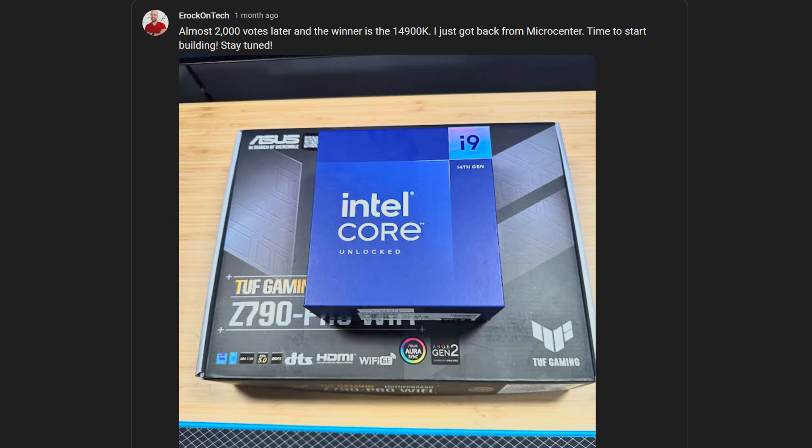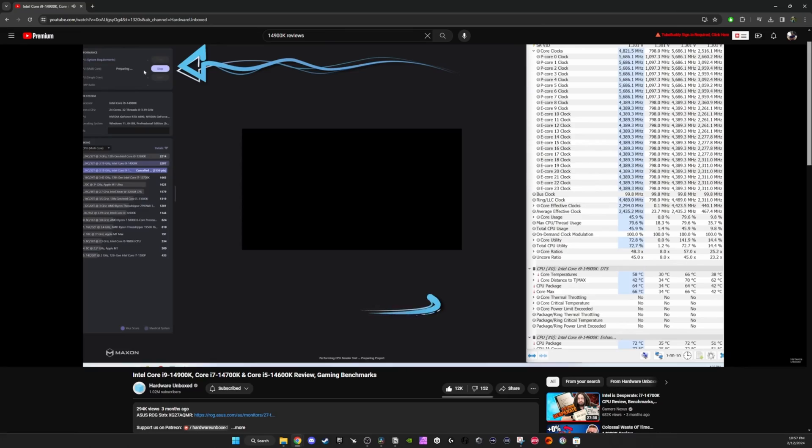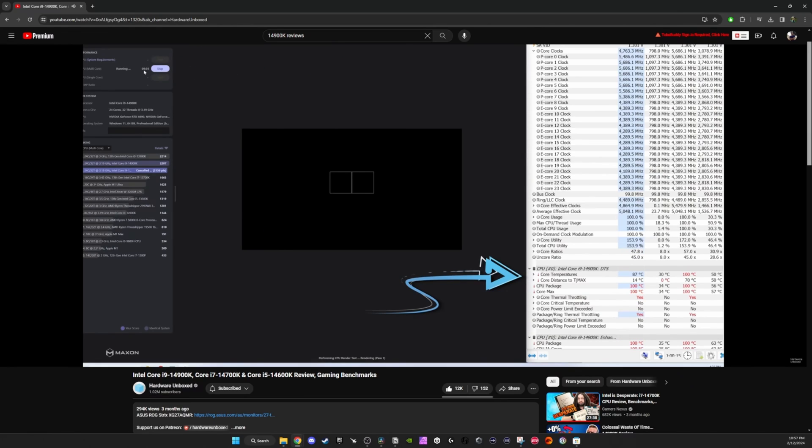I'm sorry I didn't clarify that — now I am clarifying it. Now I can tell family and friends: whenever you buy an ASUS motherboard and an Intel CPU, if your temperatures feel a little too high, go into your BIOS, check the setting for 'Disable Enforce All Limits,' and your maximum wattage will be capped, bringing overall temperatures down. To re-clarify: in my previous video I did not clarify these settings — that was my mistake. I also ended up comparing this AIO to other creators' testing results, which was not an apt comparison simply because they were obviously not using this setting.